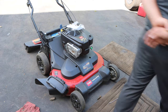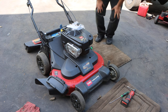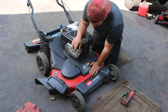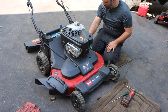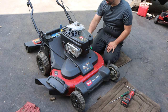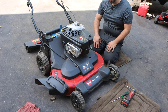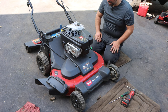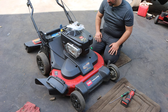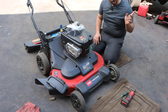Today, in the driveway, we are unfortunately working on my beloved, customized Toro TimeMaster. You guys do know throughout my channel, I do have my qualms about this mower, even though I do use it. This video will apply to a couple of machines that are not a Toro TimeMaster, and that's my problem. I run the 8.75 190cc overhead valve engine. It's underpowered. It does not belong on this lawnmower. I've done a few things to up the ante a little bit, but in the end, it is still an inferior, weak engine. And I'll show you why.